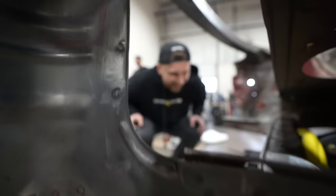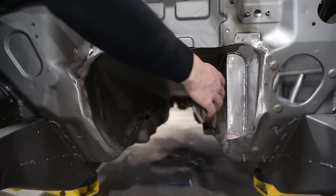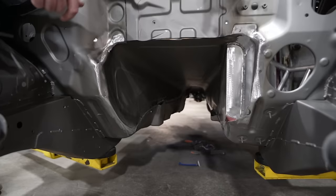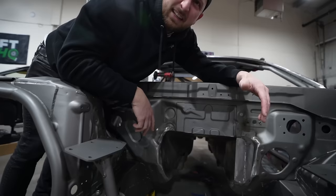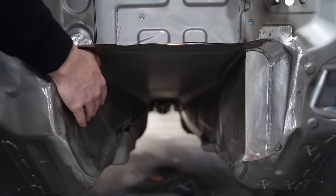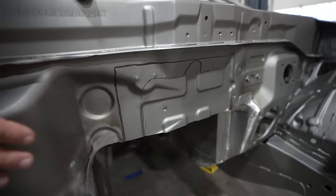We got the Warrior Tech tunnel in and it looks amazing. In pictures I thought it was going to be absurdly big, but in person it actually looks really organic in here. Now we have so much more room to work around the trans — before it was super tight and we wouldn't be able to service the transmission without dropping so many pieces. Now we can get our hands behind it, especially from underneath, and pull the trans if we have to replace a gear mid-competition. People misshift, you've got to rebuild your trans — it takes a couple hours, not too bad. All in the name of serviceability. As much as I was dreading it, it honestly ended up being a pretty easy process.